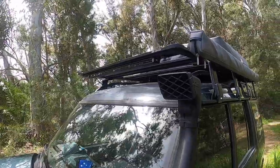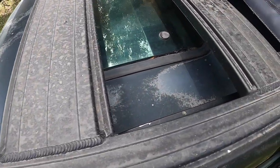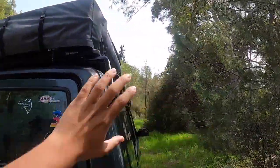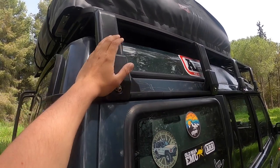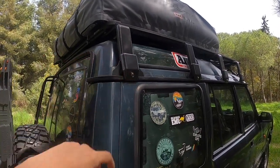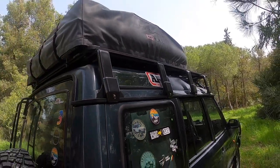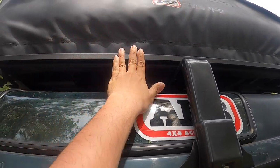Reason number three: this is actually fully welded — it's not different pieces bolted together; it is one piece. Now, fitting the roof rack on the Disco was a bit of an issue because ARB doesn't make an off-the-shelf fitting kit for the Base Rack for the Discovery 1 or 2. What we did is we purchased fitting kit legs out of an older ARB rack. They work — they just need a few modifications here and there — and everything is nice and tight, with no movement whatsoever. The quality, finish, and powder coating are so nice.